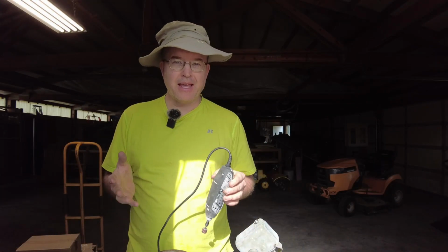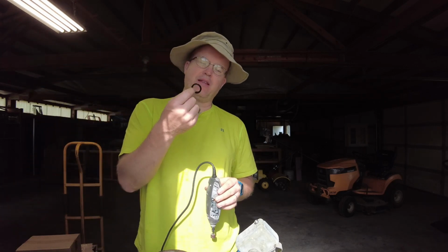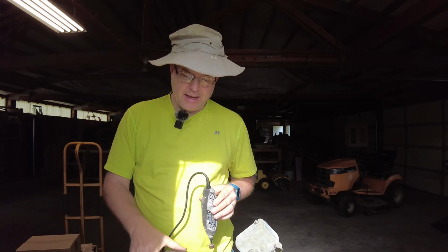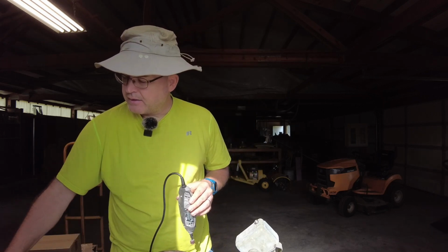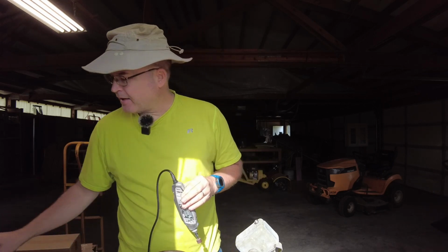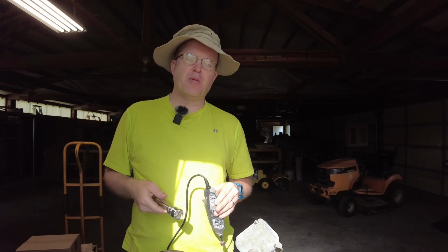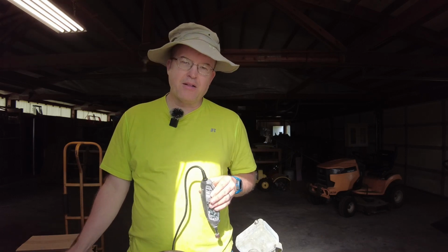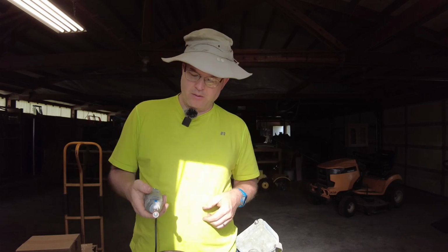This thing is proving to be a pain in the rear to get in there. It's the white ceramic thing that goes into this rubber bushing washer, whatever you want to call it, and it's just not going in there. I tried using some washers to apply even pressure, and then I'm using a big socket wrench to push it down in there, and I'm putting nearly all my weight on it, and it still isn't working. So I'm going to take out a little bit of that grime, a little bit of that rust and buildup, that has got to be a part of my problem, with the Dremel.